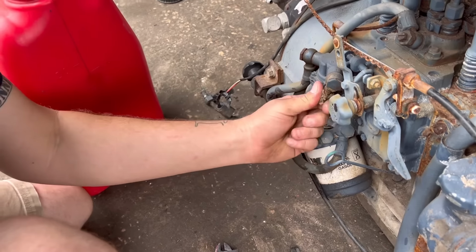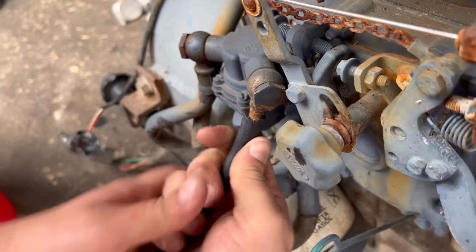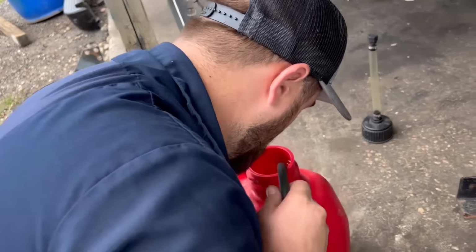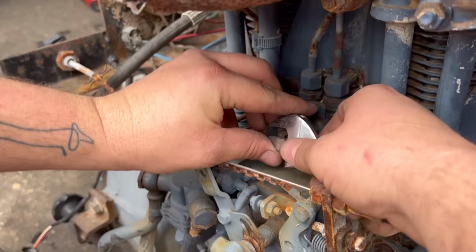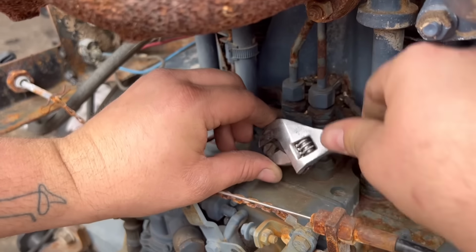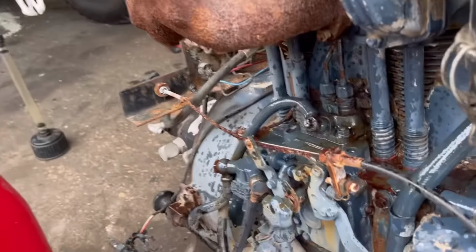All right, let me get this thing off here. Come on, there we go. Got some fuel line here. That boy right there, just push her on nice and tight. Put this in there. Need to siphon it. Now we're gonna crack this bleeder right here if I can. Open on the pump. Get some fuel going through there. Shoot. Oh. Okay. We got a gusher, folks. How's it smell? I don't know why it's got so much pressure in here.